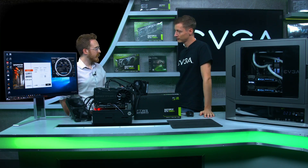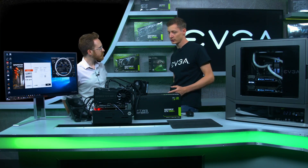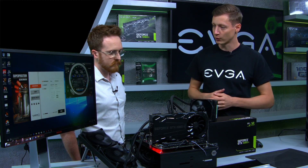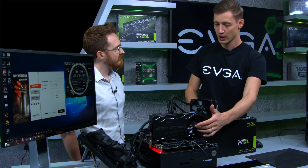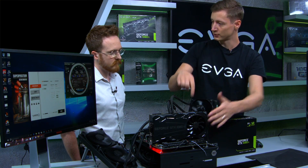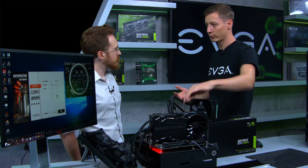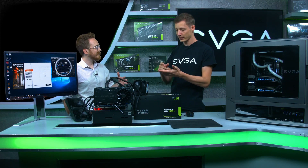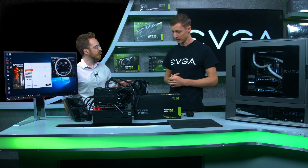Last time you were here with another FTW3 card that had ICX technology — does this card also have that? Yeah, it also has ICX technology. As mentioned before, there are nine additional sensors, and also three sensors only responsible for the power — the VR amps basically. Because we have that hybrid solution with the fan responsible for the power, this fan is controlled by those sensors. When temperatures are low in the power area the fan won't spin, so that's the silent operation again. There's a fan curve you can set in the software, so it's fully customizable.